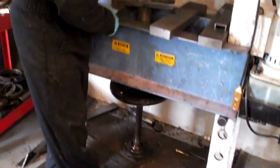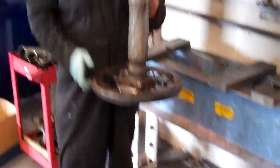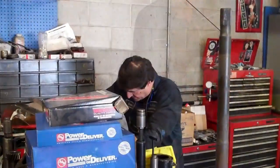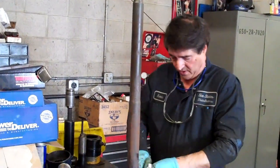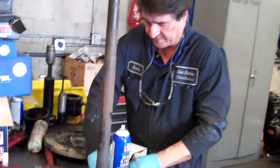Good technician double-checks. I didn't want to bend my tool on it. When you polish your sealing surfaces with an emery cloth and you don't get any burrs or anything, your seals last a lot longer. Any time you have a bearing failure there's potential to get burrs and high spots. If you press them together, the seal wants to fly off of there. So after you get that bearing pressed on there, it's a pain to get the seal back right. So a little bit of JB Weld keeps it there. JB Weld sticks a lot better than silicone — it's got more tack to it, it glues it right in.